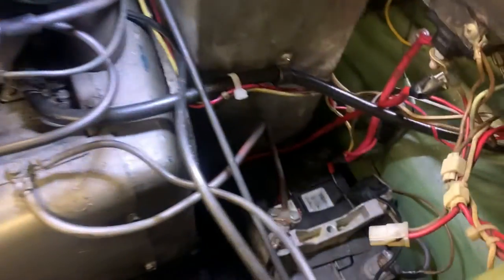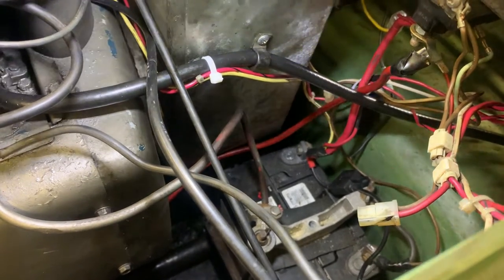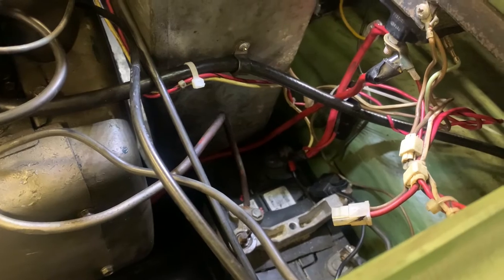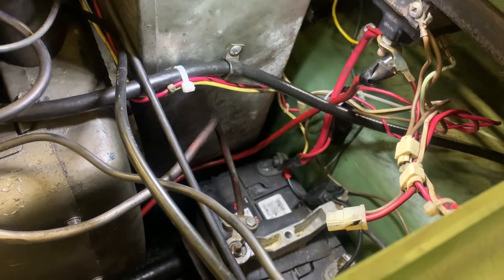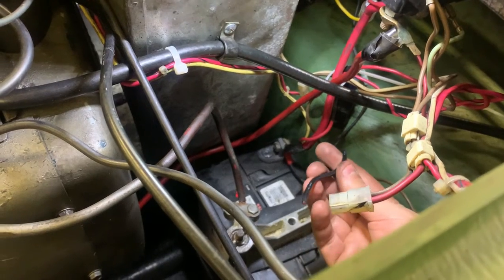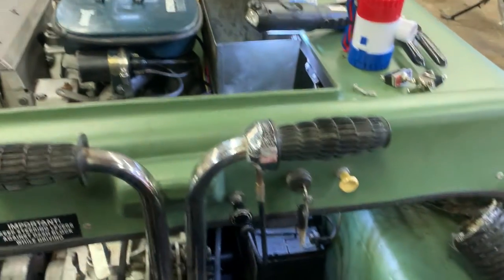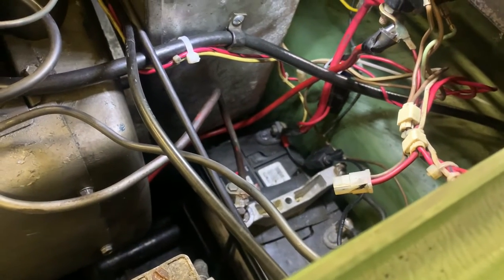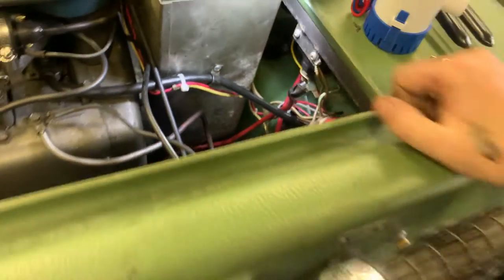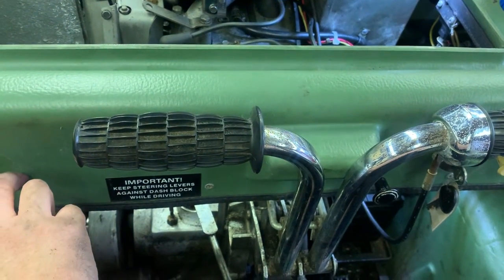I had to take a few minutes and tidy up all the wiring down here — it was worse than this, with a blue wire, orange wire, and brown wire, getting a little confusing. I got it somewhat tidied up. Down here in the back corner you can see I have an inline fused line coming off the positive, just terminated right here. I'm going to extend this and run my toggle switches right here — pump one, pump two. I have my switched power coming into the actual switches themselves.